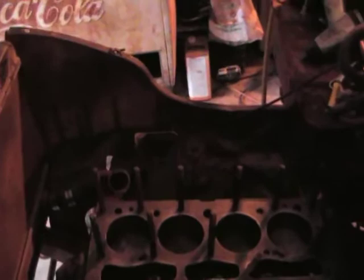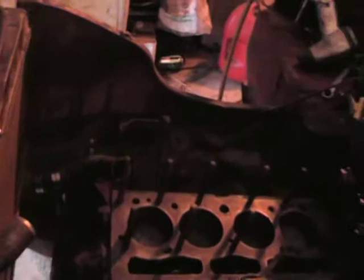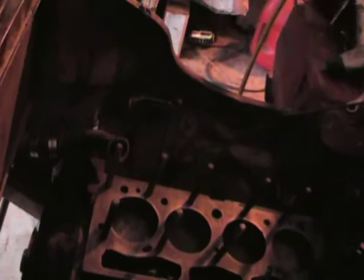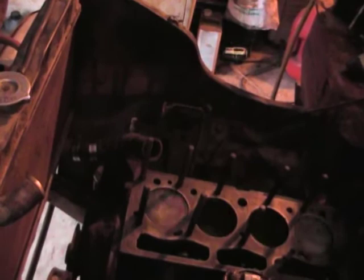The old thing was stuck - the engine was stuck, it wasn't turned over. So I was afraid something was amiss up here, so I pulled the head off and done some checking on it and it was fine. I'm thinking that the fuel pump they had on it's got the wrong arm, and it was stopping it from turning some. All I know is when they put this new fuel pump on it it quit running - before it was a running vehicle. So now it does this. Woohoo.